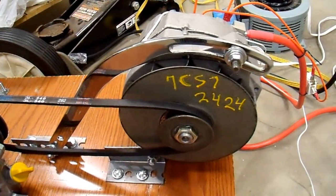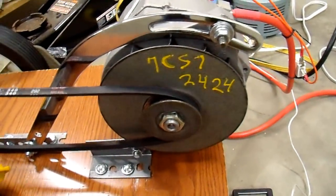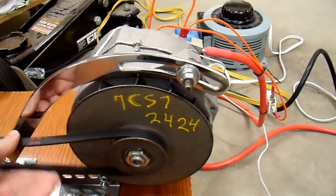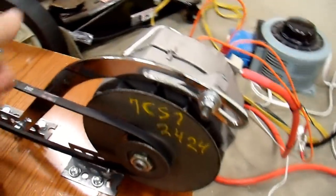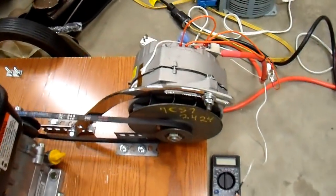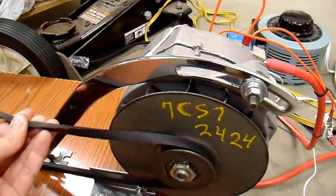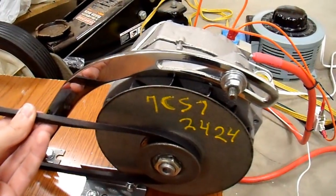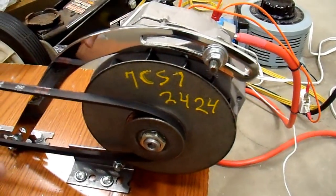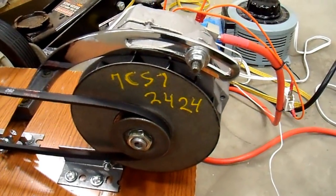So it's not really a permanent setup, but it does confirm that this alternator is a 100-amp alternator. I was going to let it run that way for a while to see how hot the alternator got, but I couldn't do that because this belt was very tight. I put a big pry bar in and really tightened it up well, but I couldn't keep this belt from slipping — it's just not an appropriate belt for this much torque. This little 3L belt just can't handle it. You'd have to have a really high tension on it and it's not going to last, and it's hard on bearings. I could potentially put the 4L belt on here but this sheave isn't designed for it and doesn't fit properly.